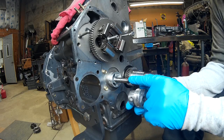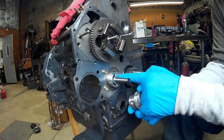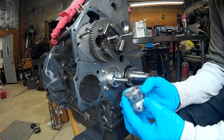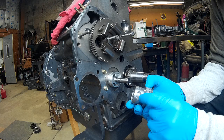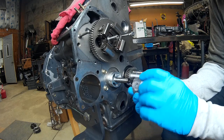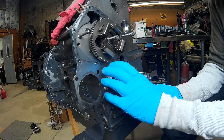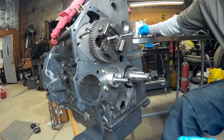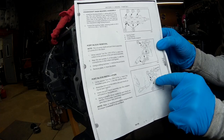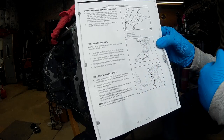To get this out, on the other side of the engine inside the block there's a nut that you can remove and actually pull the shaft out. Then you can get a bolt through there and put a slide puller on it and thump it out. This is a press fit. Because this is offset to one side and there are holes that need to line up, you can't just push it in any which way — you have to line it up so the holes are in the right place and so the shaft is in the correct position to center the gear that goes over it. They make a tool with two guide pins that you thread into some of the front timing cover holes, and then the new pump slides through this tool, holds it in the correct orientation, and you can drive it in with a drift and a hammer.